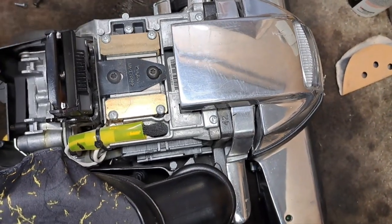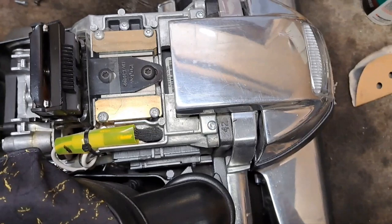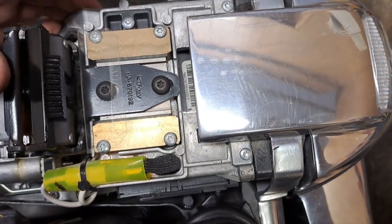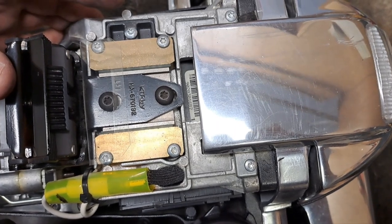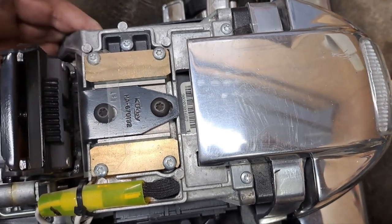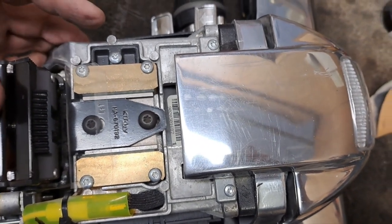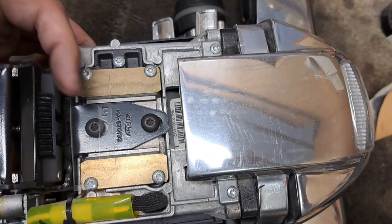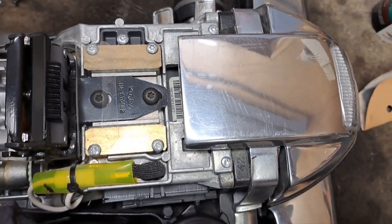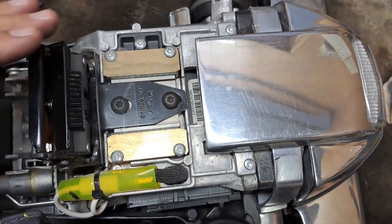That's perfect — no complaints at all. I find that if you adjust it to about an eighth of an inch of movement forward from your centering position, and another eighth of an inch backward into reverse, they seem to be really tight that way. It'll result in less wear and tear on the slide because it's not moving as much.